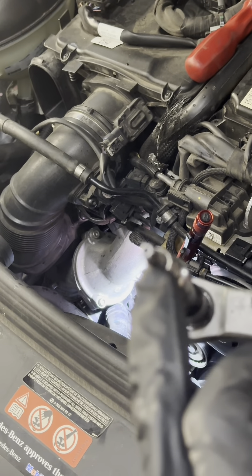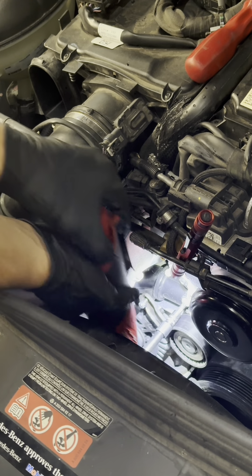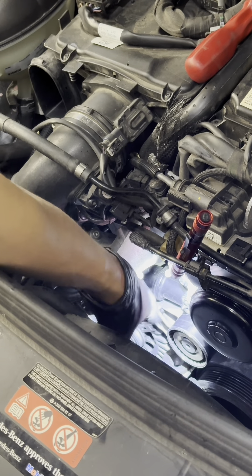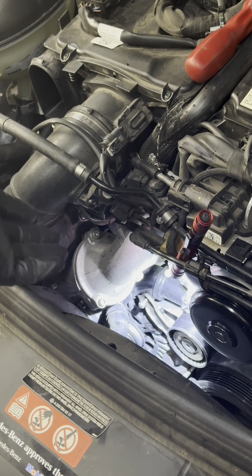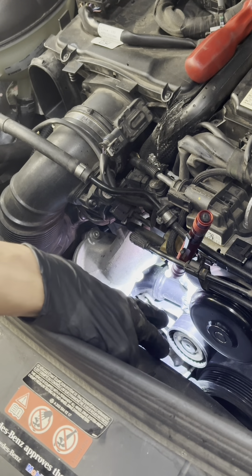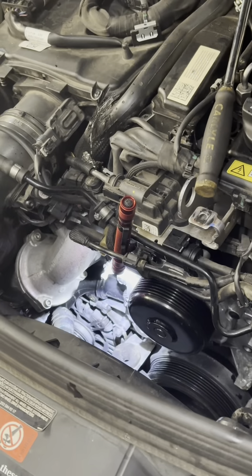The T30 has a hole in the middle — we'll get that off real quick. Pull that off. This bolt is holding on to the water pump. You can take it off once you have the whole thing off, or you can do it now — it doesn't matter. Once you have that pulled out, that bottom plastic hose right there is going to come out with the water pump, so either way you'll have to swap it over. There's a bolt on the bottom, so once you have that out you can deal with it later.